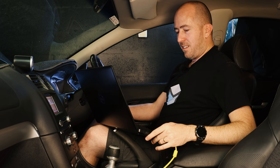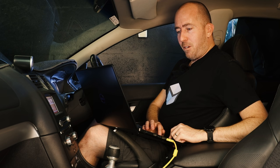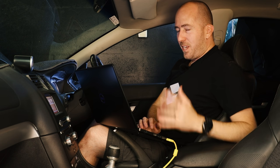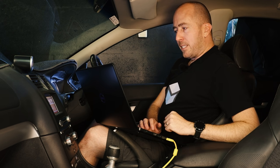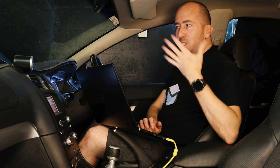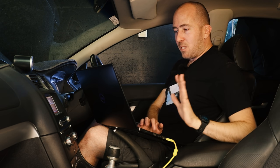Ignition off, ignition on. So I have noticed the pump primes for a little bit longer compared to the stock standard ECU. And before I try and start this car, there is one more thing I want to check out, and that is the fuel injectors. So the thing I've noticed with this car, if you've been following this channel, you'll know that it had a Redcliffe Dyno piggyback ECU. I've got a video which I'll throw up here in the corner. But what I've noticed is ever since I've ripped that system out and the stock standard ECU was trying to run this engine, it was running incredibly rich. There was a lot of black smoke coming out the exhaust, and you could just smell unburned fuel in the air, and it'd go through your hair, it'd go through your clothes. It was a really strong smell.